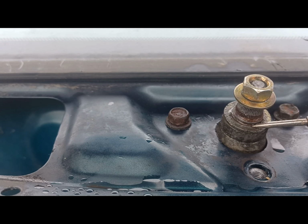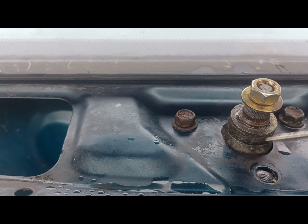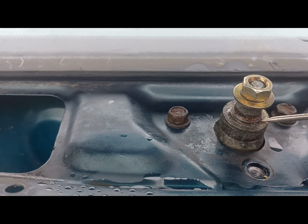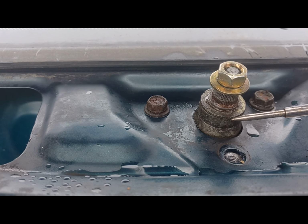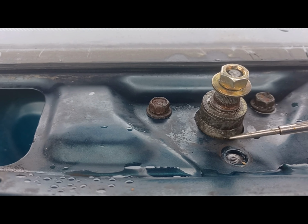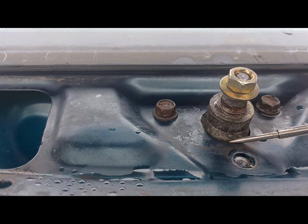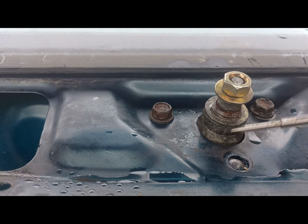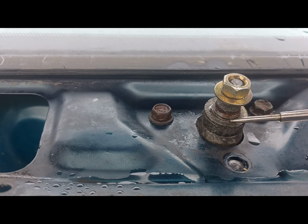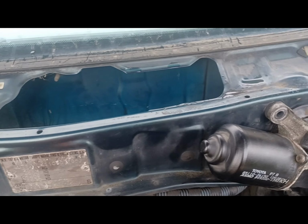And inside this is like a nylon sleeve. If it's worn, you might have to replace the whole thing, because I don't know whether there's a part. But I managed to get these out, clean up the shafts and clean the interior. At the bottom there's 2 copper thrust washers that you need to keep in place, just to reduce the friction of the base against this aluminium housing. So I re-greased it, reassembled it, put the little clips back in, and put it all back in. So it's not one of the worst jobs to do.